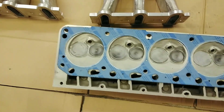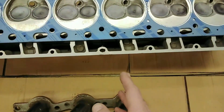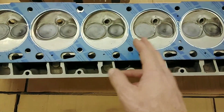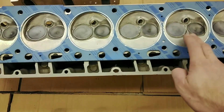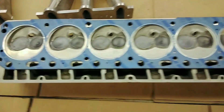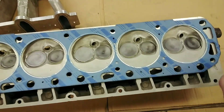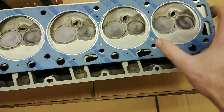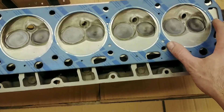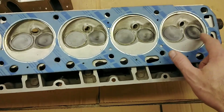I've had this bolted on the block — it does bolt up square. The bore centerline on an LS is a little bit less than the 300, so when I cut this head, the bores are offset. Cylinders 2 and 5 are directly centered over the cylinders; the rest of them are 20 thousandths offset. With the big 4-inch bore on the 300 — this one will be 30 over — you have plenty of room.